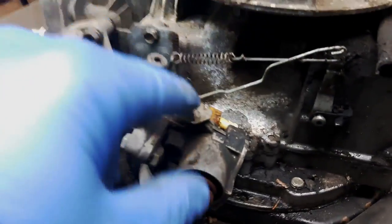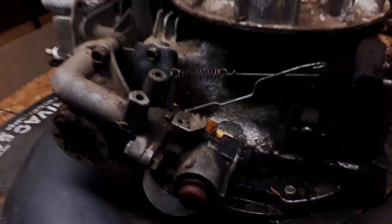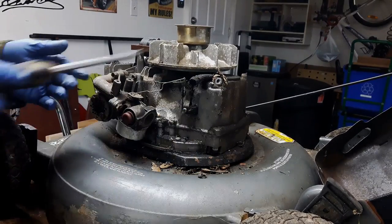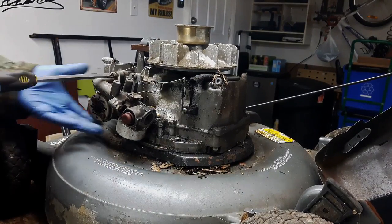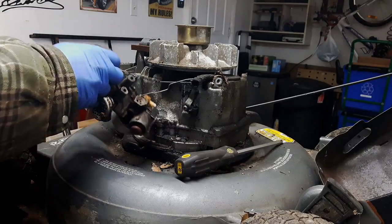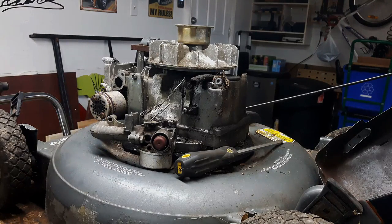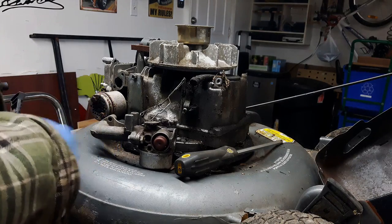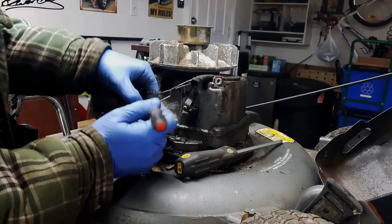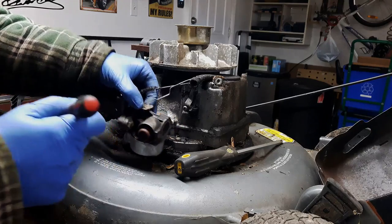This linkage goes below it, and the short end of this rod goes to the left and the longer end goes to the right — very, very important. If you don't put it back correctly it's not going to run right, so make sure you take a picture of that or video it. There is a gasket on the back side of the intake here, so if you can keep from damaging that you'll be able to reuse it. Make sure you get the scribe right into the metal, not just into the dirt, because it will hopefully wash off when you clean the carb.